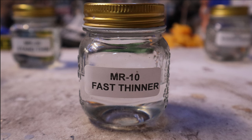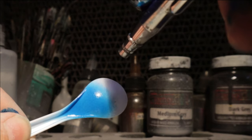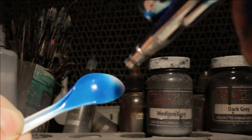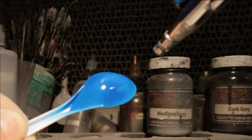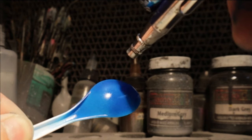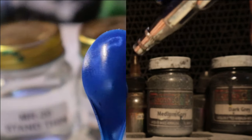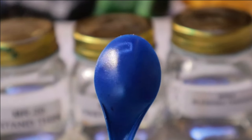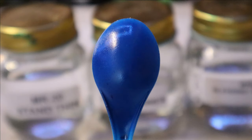Fast thinner — the common assumption is speed of work and curing, but it's more related to finish. Application is more niche and ideal for metallics or matte finishes. Being more expensive, it doesn't do gloss finishes or this blue any favors. Increased issues such as overspray, orange peel, or textured finishes are likely or commonplace.